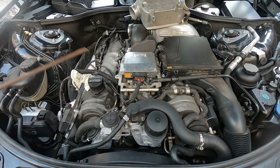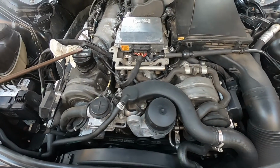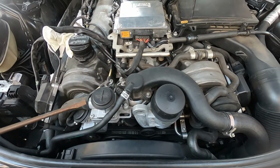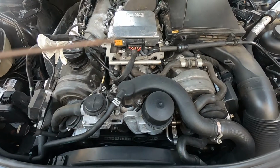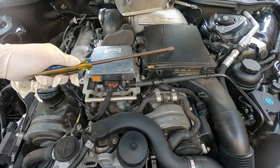Now, as we look at the engine, of course, obviously we see the oil filter housing, and here, of course, is where we add oil. This has a type of air injection system there to kind of warm up the catalyst and control carbon monoxide hydrocarbon emissions there at starting. And of course, here is the air intake, and this is one of the air cleaners.